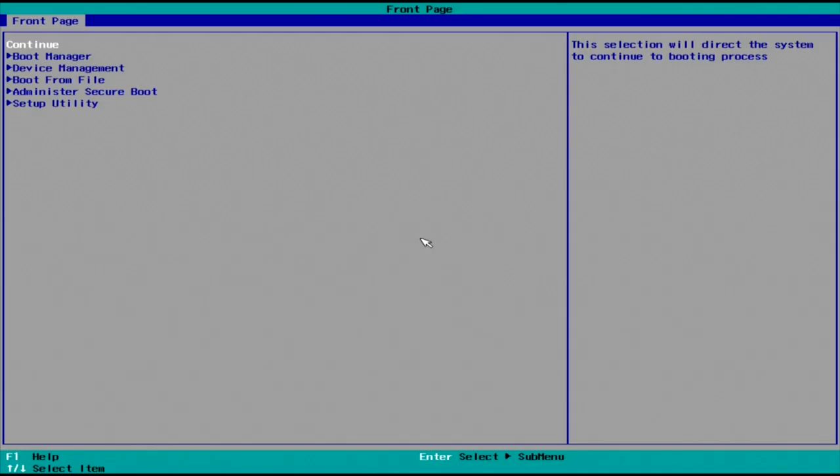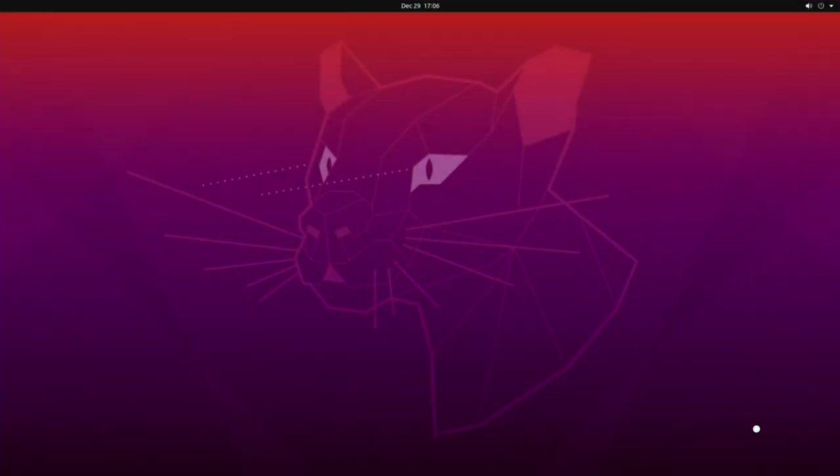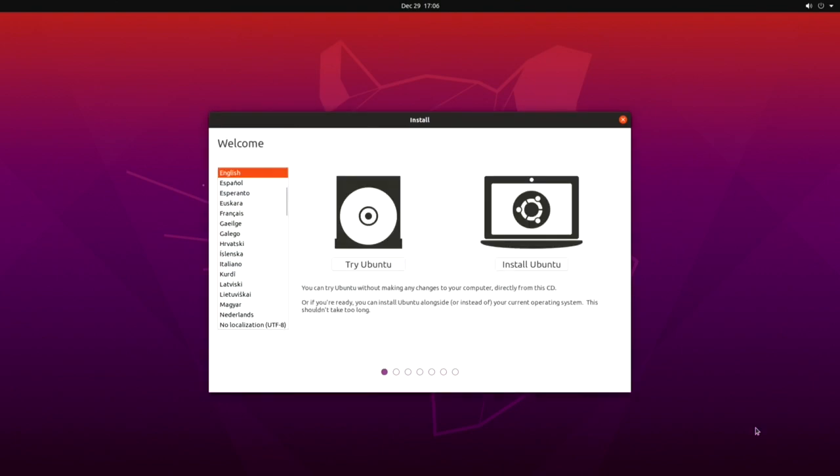Once that's created, from a cold boot, boot up your Atari VCS and then repeatedly hit the escape key to enter the BIOS and choose the boot device. If you need to boot from the USB, select that, and then your Atari VCS will boot that OS, prompting you to install. Afterwards, you can just select whatever OS is on the drive.